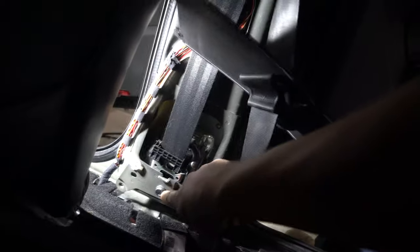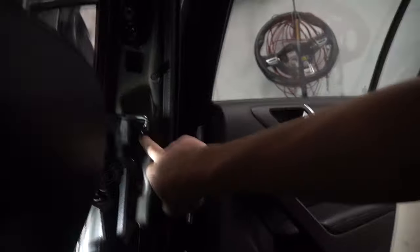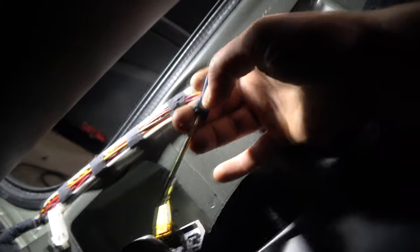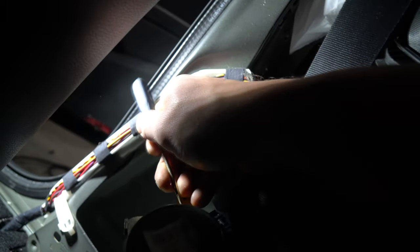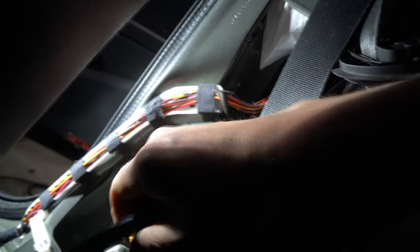We can now move our way lower and you'll see that it's just sitting in. There we go — the whole thing's exposed. You can see this right here, which we will have to take care of afterwards — this is your loop back. Right here, just like you took out the one up top, we're going to remove the triple square that's down here and then the belt will be free. Then we'll loosen these two right here — there's one here and one on the other side. This will allow us to loop the seat belt off. Once you loosen the seat belt, take a hook pick and get underneath there, just lift the safety tab right here. Then after you lift it, it should just come right out of the airbag.